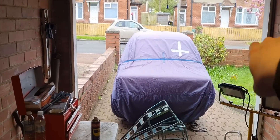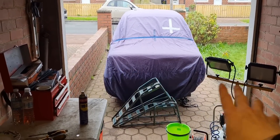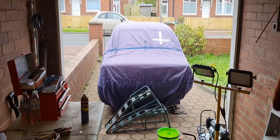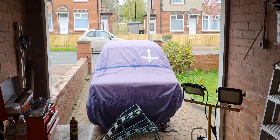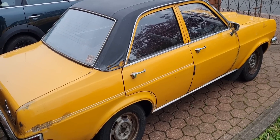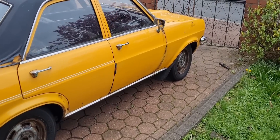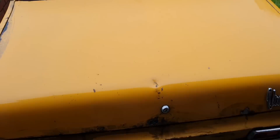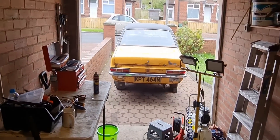Let's carry on G3ing, get the bodywork finished around the boot and the gully bit, sand down the rear valance, take the reverse light out, and get all that prepped for primer — hopefully get a bit of color on it. I'm going to spray the rear valance and the boot gutter. I've polished all up with G3 and it's come up lovely and bright. Some of the paintwork — the driver's door is pretty stained — it's taking some elbow grease to get the stains out, but a lot of it's coming out.